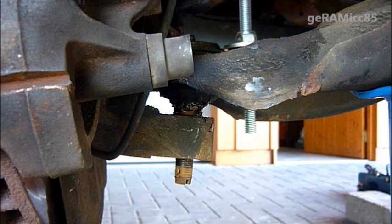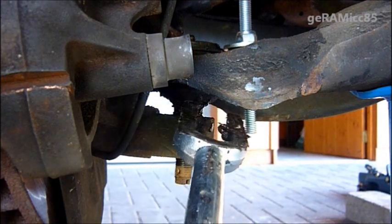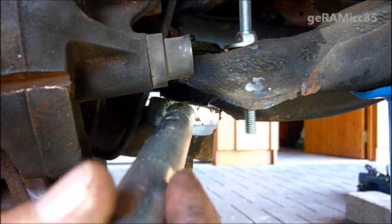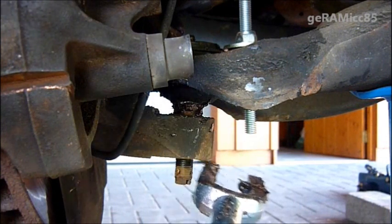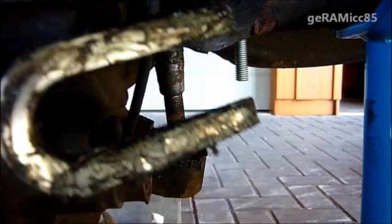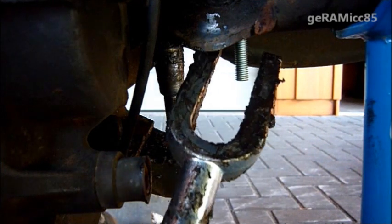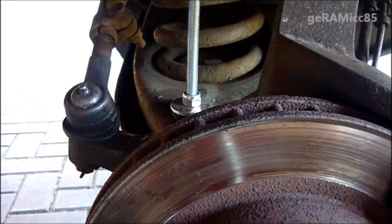I have a little problem down here as I want to use my fork. There's too much space between the lower control arm and the spindle to use this fork to press them apart. I just got off the lower control arm with this fork — I had to use this piece of metal because the gap between the lower control arm and the spindle was too big.